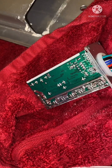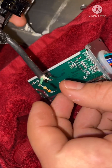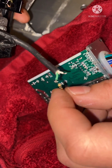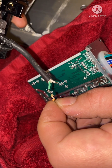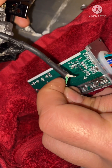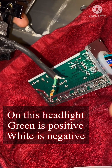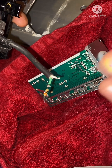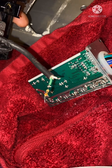I want to show y'all something real quick — I got the headlight out. So when I say to put a resistor on the positive side, in this case it's the green wire. I didn't know that. That green is actually supposed to be ground, but I had the resistor on the white wire and my light wasn't even working. I was getting frustrated, so I took it off to see what was going on. This morning I switched it out and problem solved.